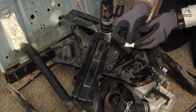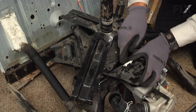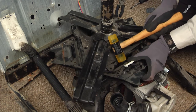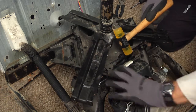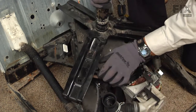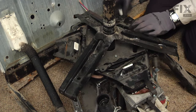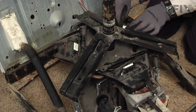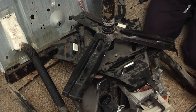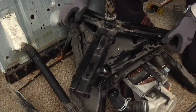To install the new suspension pads, make sure the tapered edge is facing down, then line up those two pins with the respective holes in the base plate. With a soft faced hammer, tap those sharply until they lock into place. Do that for each one — you may have to move that suspension plate around to get good access. Make sure they are secure, then lift the tub support up again and rotate the suspension plate back into position.